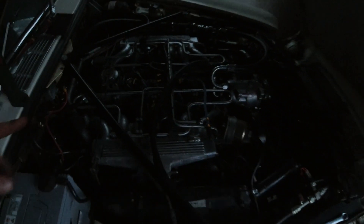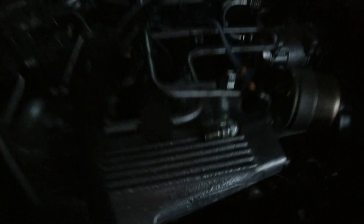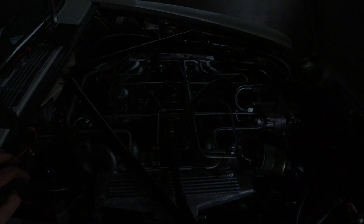The plug wires are back on. I've laid a loose spark plug here and I'm going to see if the ignition is on — I'll just jump the starter here and see if we see a spark on there. That was a really nice blue spark — really, really strange. I think it's definitely spark-related even though it looks like I have it. I removed one of the plugs — these are just one season old — and look at this: it's quite a weak little spark there. So something is definitely going on.